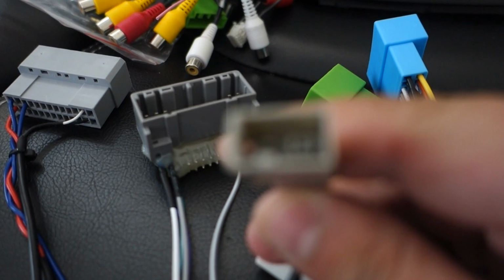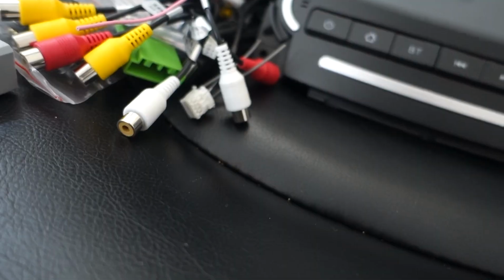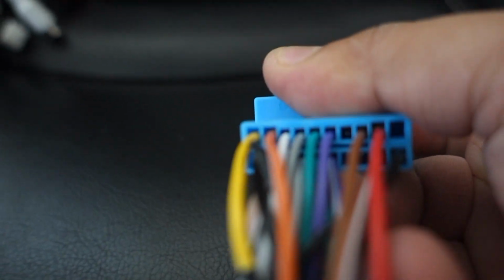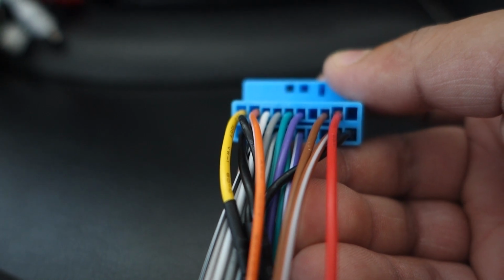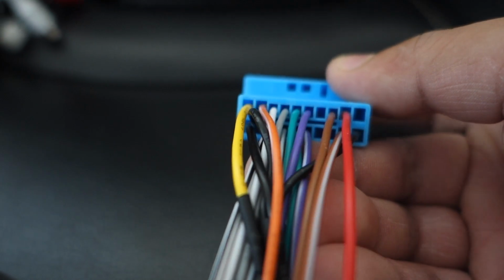Something else I wanted to show you was that they sent the 26-pin connection instead of the 40-pin, but they gave me an antenna conversion that's only used for an 07-08. So I'm going to unpin that, and then I want to see what's in here. So the antenna turn-on is missing. I wonder why that is. If you get this kit, we might have really bad radio reception, and the reason why is there's no antenna turn on. So I might reroute that myself